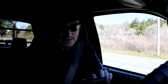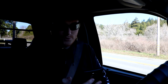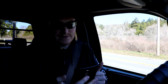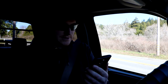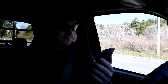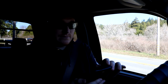So we're in our second location here and we only are showing one bar with one X, and the Network Cell Info is showing we're roaming at negative 106, but it's one times RTT roaming. So it's pretty much nothing. Let's go ahead and try and do a speed test before we turn on the booster. It's searching. Now I'm showing just one bar with no data of any kind. And it's not even going to be able to find something — it's looking, but it's not finding anything. So let's go ahead and plug in the booster and see if we can get anything.